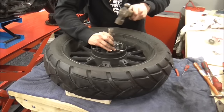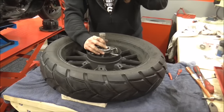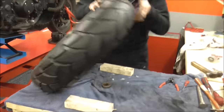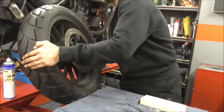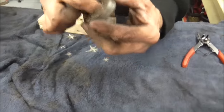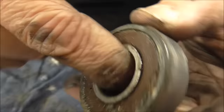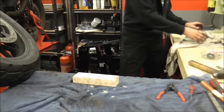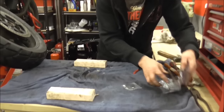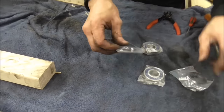It's the bounce in the hammer - you don't get that bounce. It hits with a dead sound - there it is, there it is. There's the bearing. That's the offending bearing. It just feels like it's full of sand. I ride this bike every day - this is just wear and tear. There's nothing wrong. No complaint with all our spare parts.